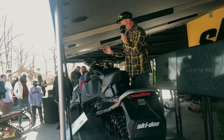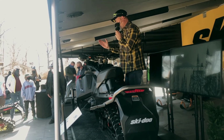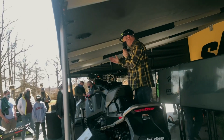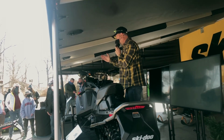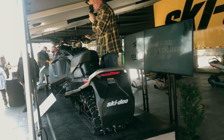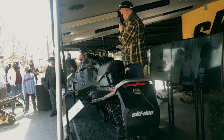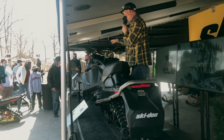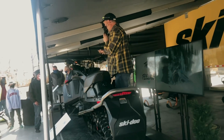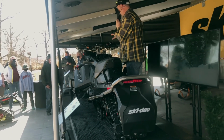There's a spectrum in Comfort where it's constantly adjusting compression and rebound. When you go to Sport, it's a little stiffer, constantly adjusting compression and rebound. And Sport Plus, the same thing, even stiffer, but constantly adjusting compression and rebound. This sled will change the shocks up to 50 times a second if it needs to, all depending upon what the sled is calling for. Again, dictated by your throttle, your braking, the roll and the pitch of the sled, the acceleration. It understands every single bit of it, and it reacts to everything you do with it.